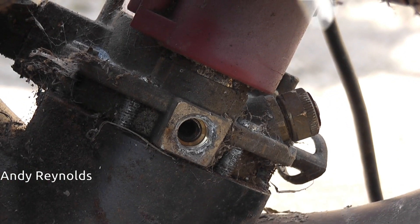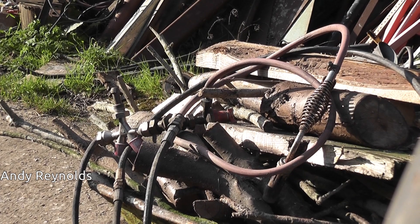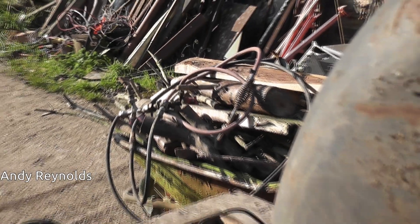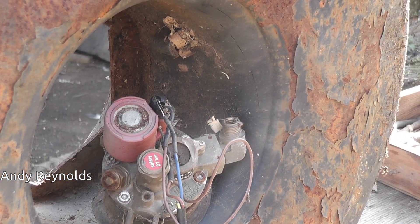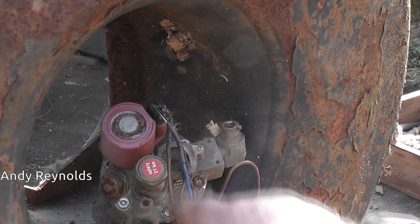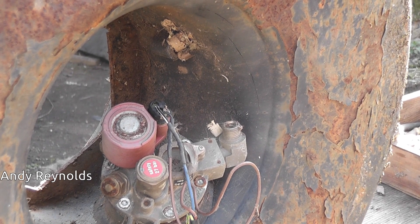What we need to do is attach that adapter to this, and then over there on that wheelbarrow we've got the rest of the pipework — apart from the blow lamp which we don't need to attach. Then we'll get a gas cylinder and a 12-volt battery and energize the solenoid. There's the solenoid loop — that is the input. There's the solenoid, there's the wiring; put 12 volts into that and it opens up a valve.